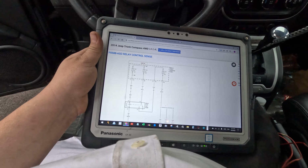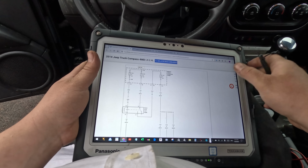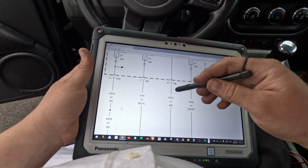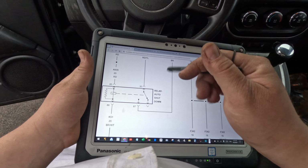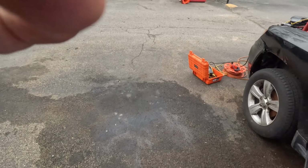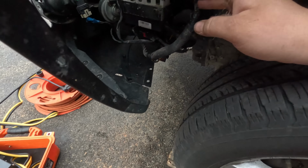We know right now that we have no power on this fuse, which comes out of the auto shutdown relay, and it goes to, let's see, coming out of the relay is connector 8 under the TIPM, 22. So maybe this relay is not inside. I gotta find this relay. Alright, it seems like the ASD relay is under here. Yeah, here's the fuse box. Okay, great.